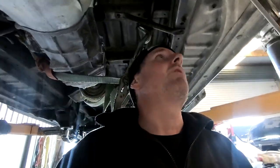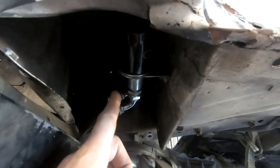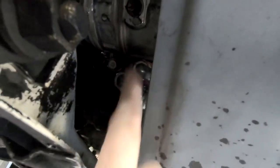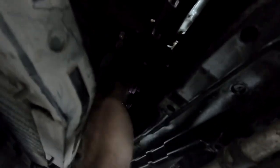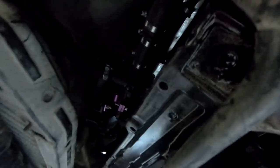Remote oil filter — I'm not a big fan mainly because people get them wrong, but we've sat down, had some lines made, and mounted the remote oil filter up under there. The lines run round to underneath the air conditioning pump. If it didn't have air con we'd do it differently — just put a little filter block on — but with air con, we run the lines through and put a remote oil filter. There's also a big helper pump mounted up under here in front of the radiator. This thing's got a double radiator — one sitting flat and the second one sitting vertical — and the helper pump helps the flow through the front radiator and reduces temperature.